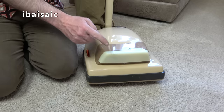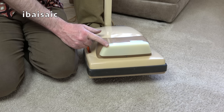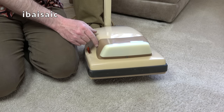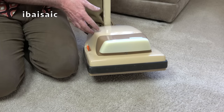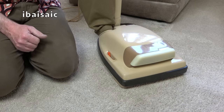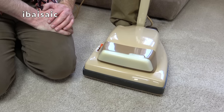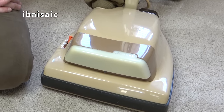So what I'm going to do with this lovely cleaner is fit a headlight bulb — it takes the same bulb as the Turbo Power One and Turbo Master cleaners, and I think the Kirby as well, just a small push-fit round bulb. Also a new belt, and I might even treat it to a new pair of brushes. Absolutely chuffed to little mint balls with this 1982 Hoover Dirt Searcher. If you have any comments or questions, please comment below, don't forget to thumb up and subscribe, and I'll see you all very soon.